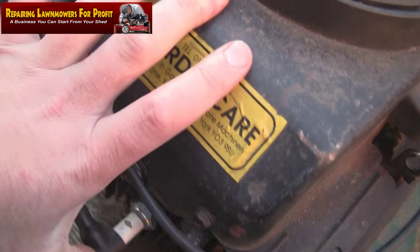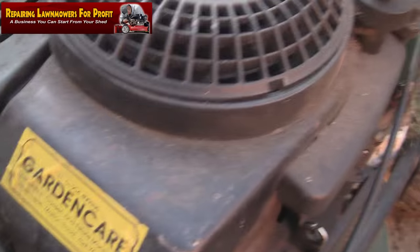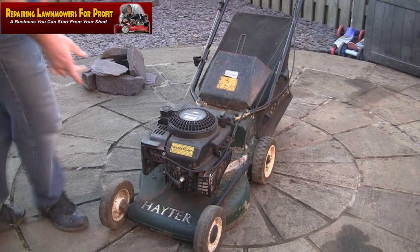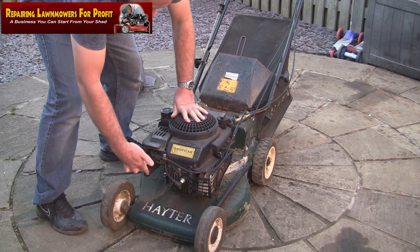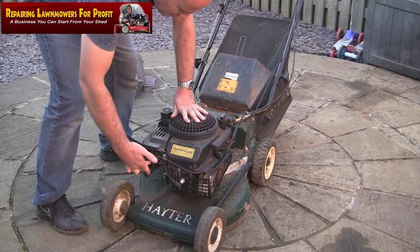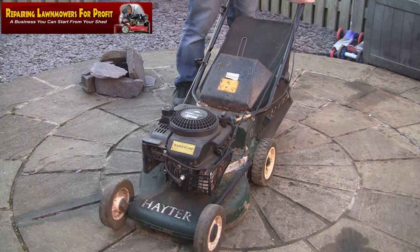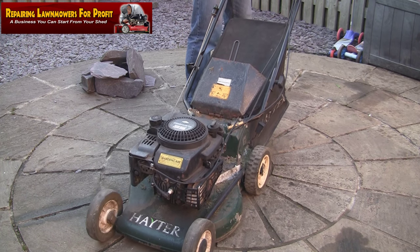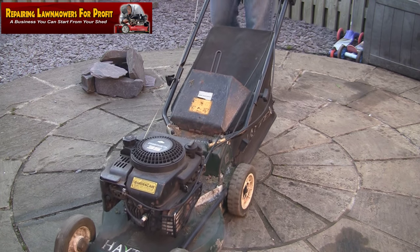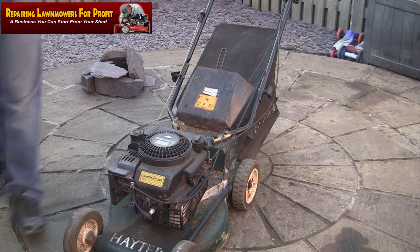I always get this — there's nothing wrong with it, it's just the fuel. I'll give it a couple of tries and see if we can keep it running. I've checked the blade's on right, let's give it a bit of fuel. Primer ball feels alright, seems to be working. I'm pretty sure it's a bowl carb on these. Just try it — I'll put it on choke. Basically that's what happens with it: it starts and it just dies. Let's extract this fuel out and try it a couple of times, see if we can get it to stay running.